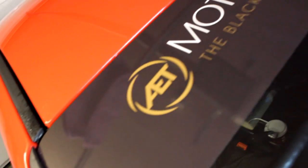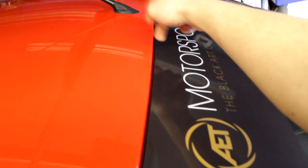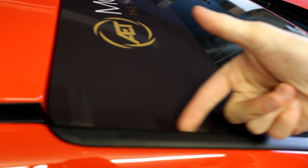And just like that the sun strip is fitted! On this side I've cut along the windscreen edge so it's nice and flush. I was struggling to tuck it in behind, so go with whatever you find easier — every situation is different. I found it easiest to cut along the windscreen as it leaves a nice edge. Start from the top of the windscreen and work your way to the end and then around — cutting from top and following with your knife round is so much easier.